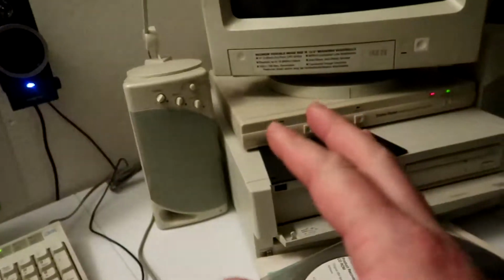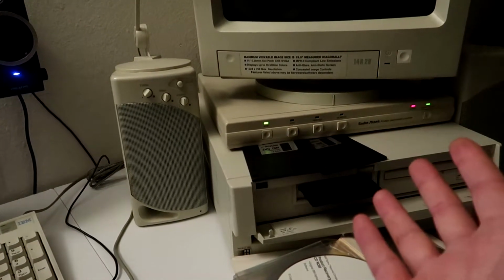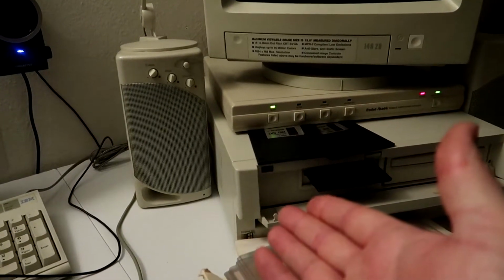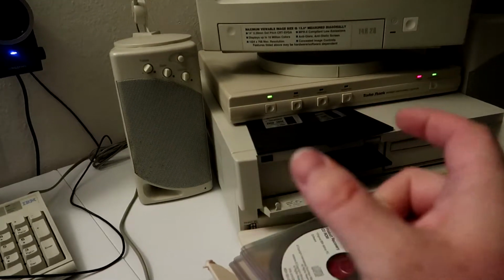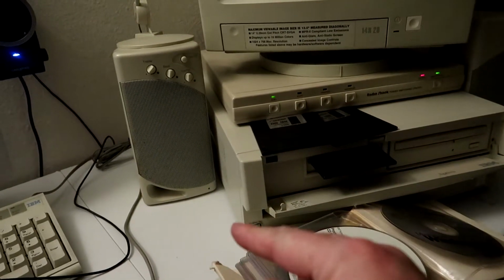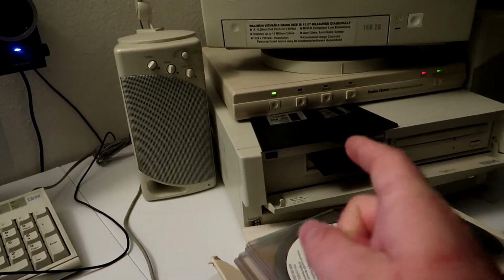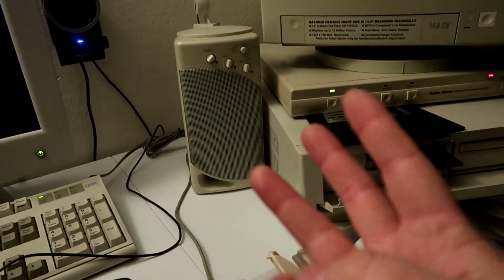And at this time, during this computer era, to run 3D graphics, some games would run the 3D if it had them, but in order to run the other 2D, you still had to enable your old sound card or your old video card. You had to leave it in there, and they had a daisy chain to connect your old video card coming out to your new video card, and from there it went to your monitor. That way you could run 2D graphics, and then the new card would run the 3D graphics.